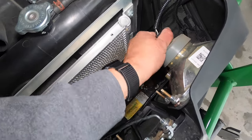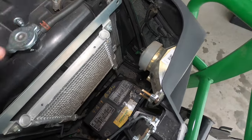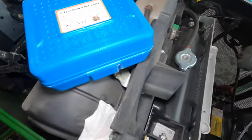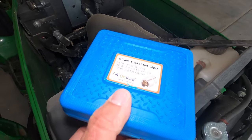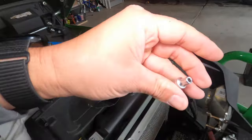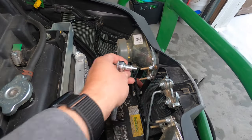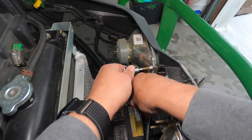The first thing you want to do is remove the connector from the wiring harness and just put it to the side. This requires kind of like a reverse or female Torx bit. I found this on Amazon — it was pretty cheap, I'll put a link down in the description. This is just a small set. In this set, this is an E5 socket — that's what's going to fit this. To remove the headlight we need to remove these studs, so I'm going to use my E5 socket.